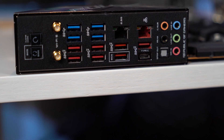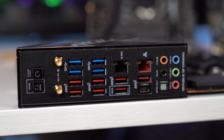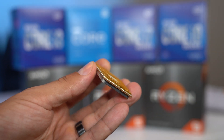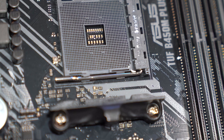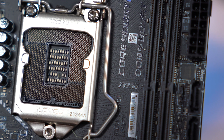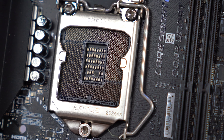This is why you often see pre-built systems using micro-ATX boards. Keep in mind that the biggest constant on motherboards is that they all have a CPU socket, and the CPU socket needs to match your processor. The current socket for AMD is AM4, while Intel's current socket is LGA1200. The AM4 socket has a bunch of holes because there are pins on the CPU that slot into them, while the LGA1200 socket has tiny pins in it that make contact with the pads on the underside of the CPU. For now, this makes it easy to identify an AMD or Intel motherboard, although this might change.